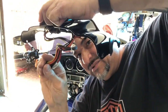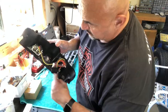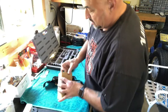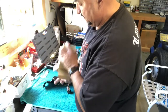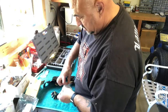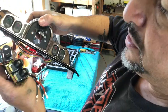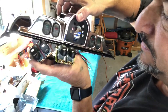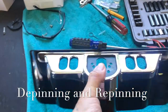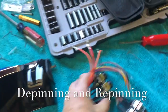And just like that, we got it off. So what I have to do now is take these four screws off — one, two, three, four — pull these switches off, then de-pin this. And here are the new rocker switches. They look pretty dang amazing compared to the others. So we're talking about this lower fairing switch housing, the rocker housing. These are the new switches: spot and speaker, and the cruising accessory.